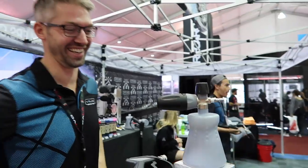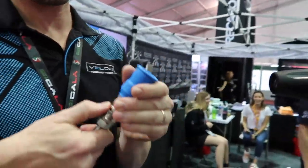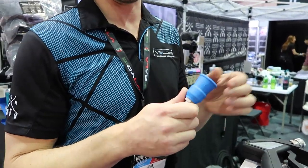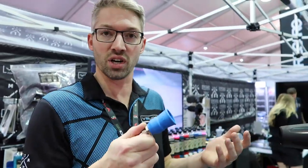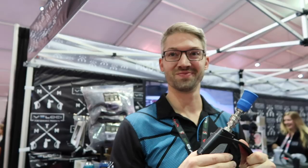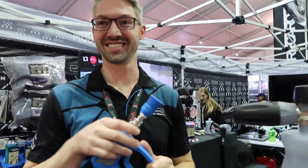When's the PF23 come out? That's what everyone wants to know. I plead the fifth. Last thing — the tip on the wand. We're talking about 316 stainless. It is a nozzle guard. The whole concept is that even with the hardened plastic for the QC tips, if you hit it, you will still scratch and dent. So this is a rubberized material — it is food grade, you can see the symbol on there. In the professional industry you use this for overspray, and in the detailing world, of course, you don't want to hit the vehicle. When you engage a tip and it doesn't engage all the way and you shoot it out, at least you're not going to take it apart. The trick is to always aim it to the side first, then come back.